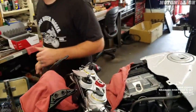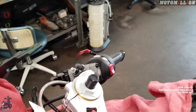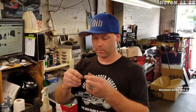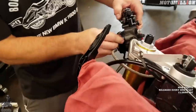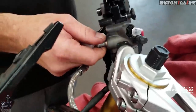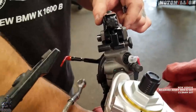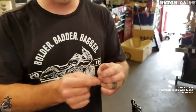We'll leave links for the complete system that Manny sent us from Moto Million so that if you want to do this to your S1000RR, we've already done the research on what works. Now, most manufacturers use a coarser thread banjo bolt than what comes in this kit. This Brembo kit uses a 1-millimeter pitch thread, while Japanese stock fittings are usually 1.25 millimeter — a coarser thread — so you may need to source a different bolt.